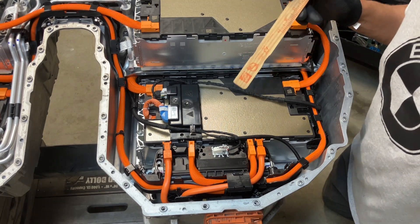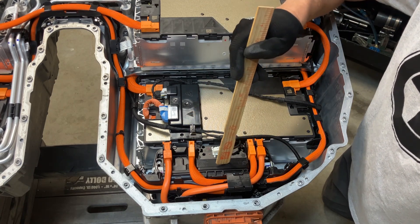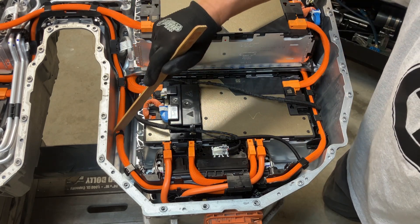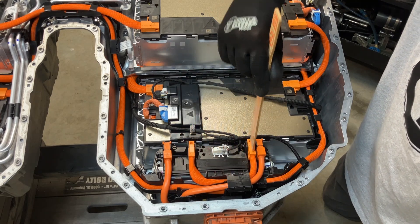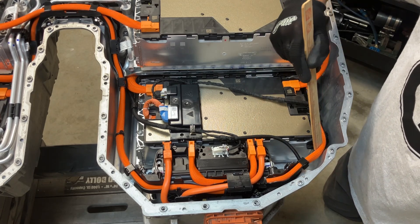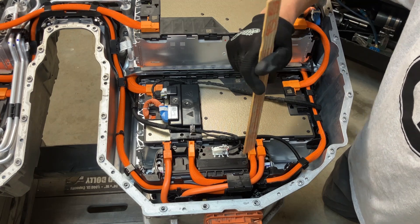Today's video will end after we read the voltage of the battery pack across the six modules before the electricity enters the safety box. All these wires here are live right now, but not to the outside. This lead from module one crosses over and comes into the safety box here, and this side is module six, which comes in here. We're going to unplug those — and we have to be careful because these are live.